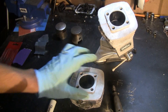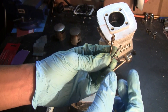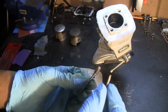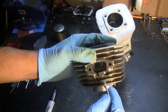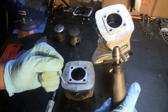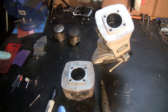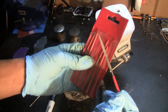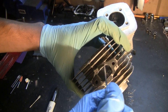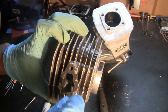When you want to round out the corners of your exhaust port, here are two tools I like to use: tungsten carbide bits — I'll link those at the end of the video — these are eighth-inch shanks by quarter-inch heads, and they do a fantastic job getting into exhaust ports and intake ports. I also have a Dremel tool with a flex shaft, which is pretty much required for real port work. If you don't have power tools, you can resort to a filing kit, which does a great job for fine tuning along the sides, though it takes a bit more time.